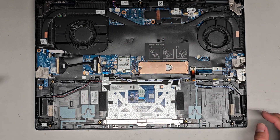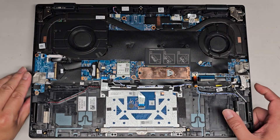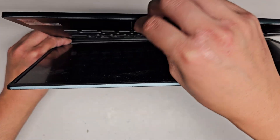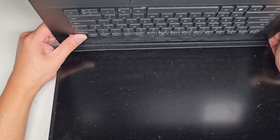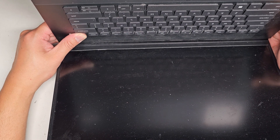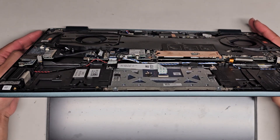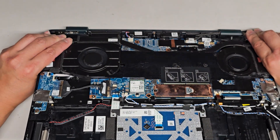So I'm back. Let's go ahead and continue — we're going to have to carefully open this up. There's quite a bit of dust. I'm going to press and hold the power button for at least 15 seconds to drain any residual power. This is important, especially since we're messing with the screen — you don't want to do this when there's still power in the board. That's why we pulled out the battery. After we hold this button down, we're going to go ahead and continue disassembly.